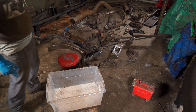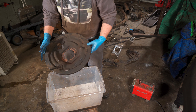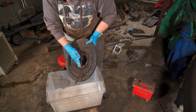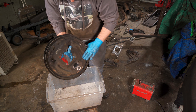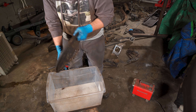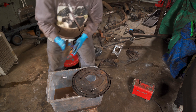I have got a mountain of stuff to go through. Not everything in this pile is getting the same treatment. Some stuff needs to be brought to bare metal, de-rusted, de-greased, primed, and all that. Other things might just need to get scuffed and painted. Other stuff might just need to get cleaned up — obviously I'm not painting the exhaust. Once I'm done and I've got every single one of these pieces cleaned and painted, I'll have it tucked away, organized, and ready to go. As I'm reassembling the truck, I can just grab a nice clean piece, bolt it on, and continue on. So that's the general idea.